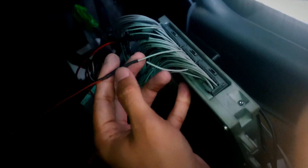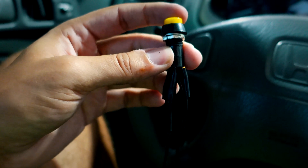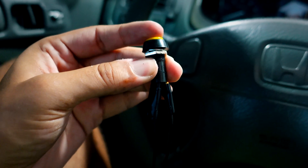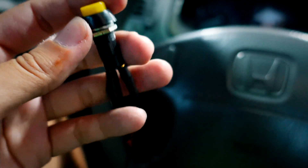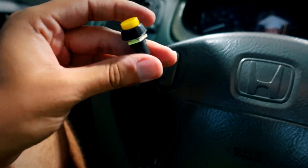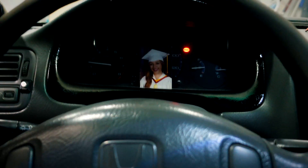As you can see, that's the plug and you would wire it to ground. I'm going to wire it to the ground on a bolt. One side is the ground going to the car, the other one's the ground going to the ECU. So when I press the button it closes, creating a connection ground telling the ECU to engage anti-lag. I take them off just in case I'm grabbing in a weird way so they don't ground when I don't want them to.